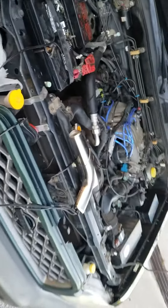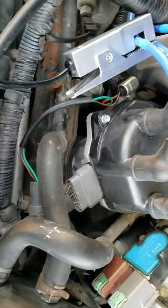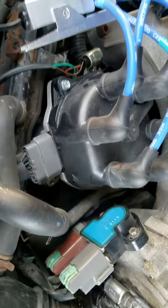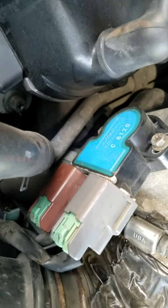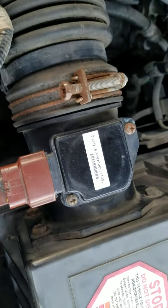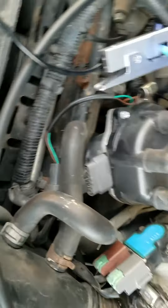This distributor I bought was a cheap one from Amazon, and the only thing I can think of is it's failed. I've also put a new crankshaft position sensor on — it's set right. I've put a new MAP sensor on. I'm still having that misfire.